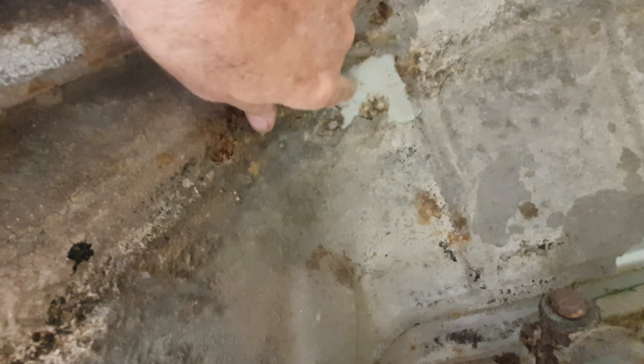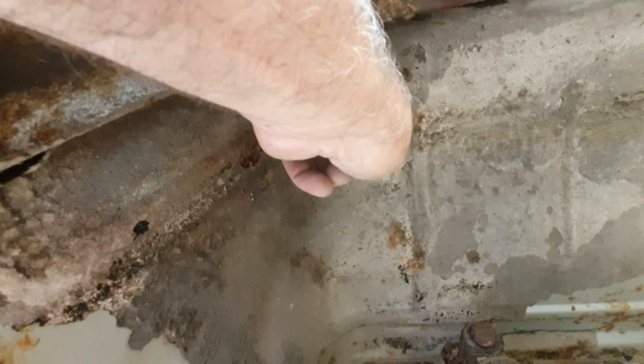This part here is mostly just undercoating that's falling off, so I'll just have to scrape it all off — it's going to take me a while to do. You can see all the stuff where it's just bubbled. The problem with undercoating is as it comes loose it doesn't adhere well, and water gets behind it. When it's got a little bit of salt in that water it starts to erode the paint away slowly. As soon as it compromises one part of the paint the rust starts, and it just works its way along until you have rust holes — that's kind of how it happens.